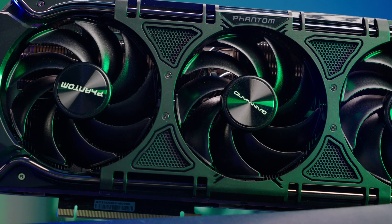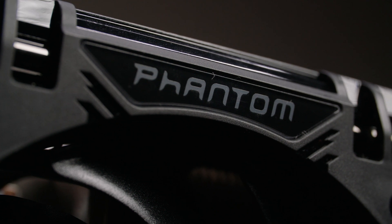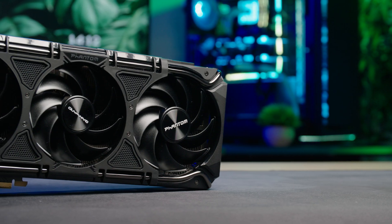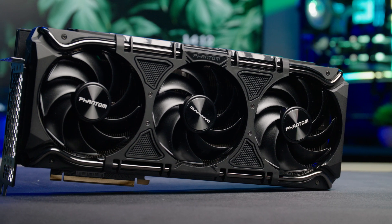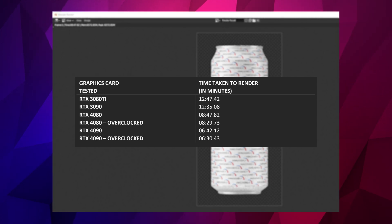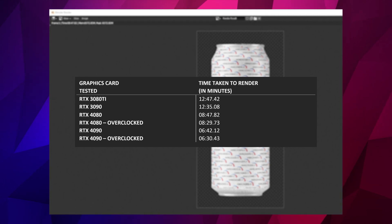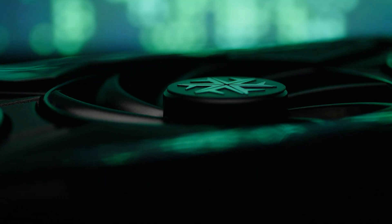It was a great performing cooler and very silent. Now let's look at the stock performance of this 4080. I wanted to test professional benchmarks such as Blender rendering, because these totally remove any CPU bottleneck. In our Blender OC UK test, the 4080 is 30% faster than the RTX 3090 and around 32% faster than the 3080 Ti, which was a great result. I also observed the 4080 is 31% slower than the RTX 4090, which supports NVIDIA's claim that the 4090 is more suited to the professional user who needs that extra GDDR6 and extra clock speed when there's no CPU bottleneck.